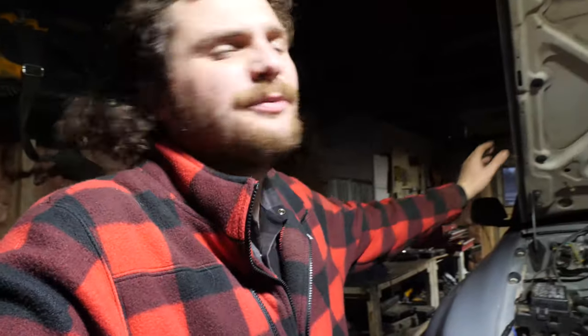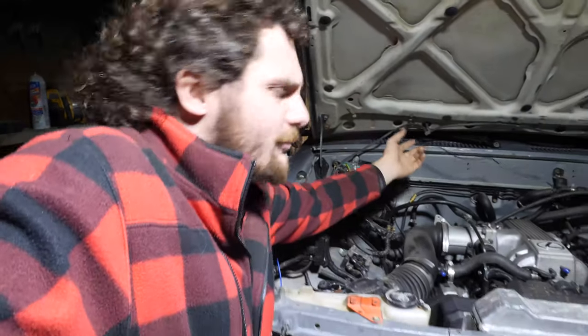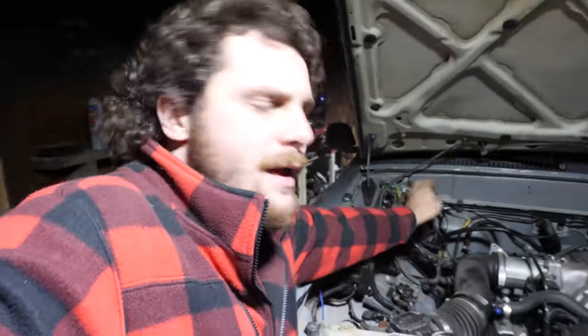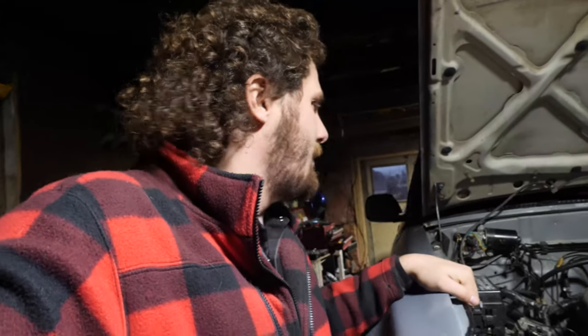One of the issues of running these rock lights is there's so much random wiring that goes absolutely everywhere. I've been going back and forth trying to figure out where exactly I want to put the control box. I'm mounting the control box right here behind the factory fuse box, zip tied there. I have the leads coming up right here on the firewall — this lets me connect the front ones easily and then run two leads back into the cab to pick up the rear wheel wells. Hopefully I get this cleaned up to look somewhat presentable, because honestly I've been trying to keep my wiring as clean looking as possible.